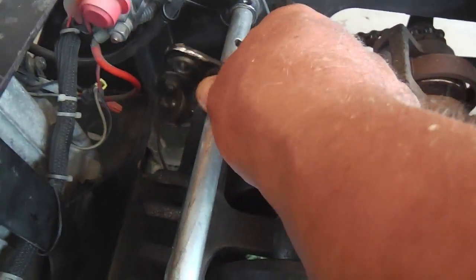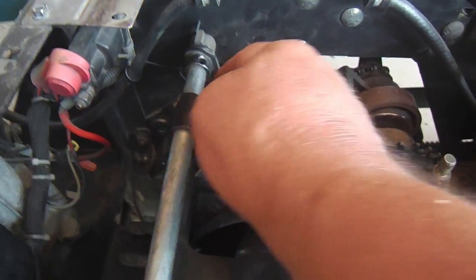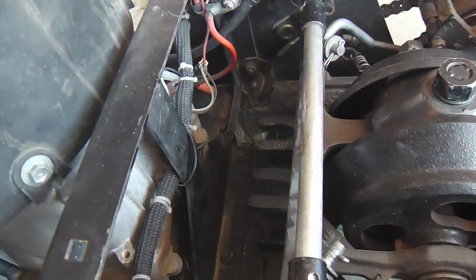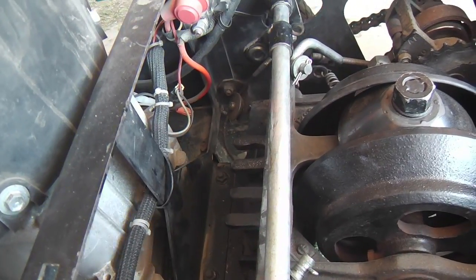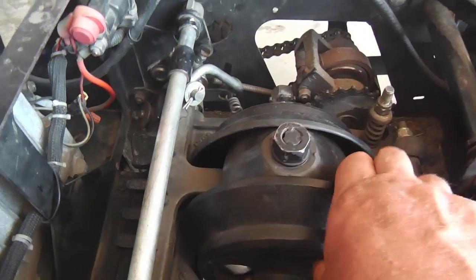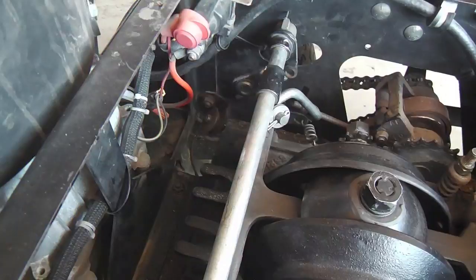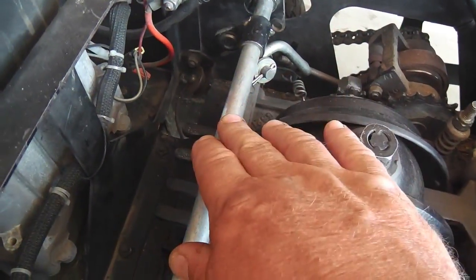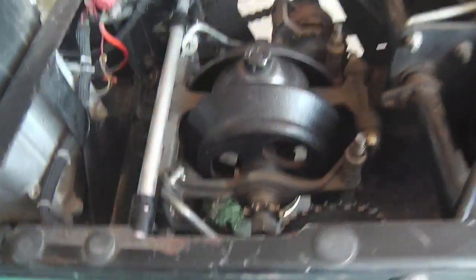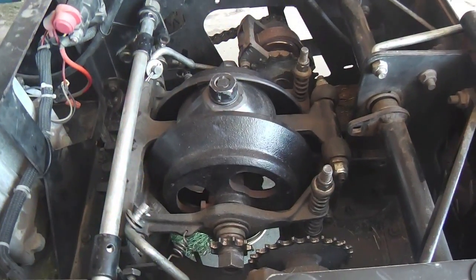And then I've driven the roll pins out for these brake mechanisms and other idler release mechanisms. And then the rod has to come out here that straddles the whole compartment, because this won't come out without it. It looks like you can almost get it, but in the literature this has to come out. Once you get it to this point, it doesn't take too long. Also, of course, I took the chains for the sprockets out on both sides, but that's pretty much it.